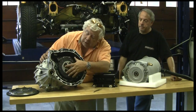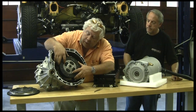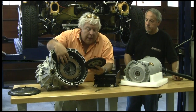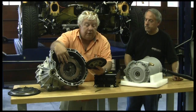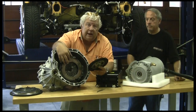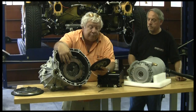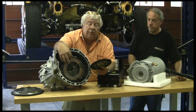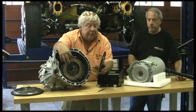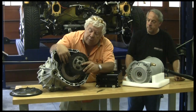We're going to keep the clutch — this is a brand new one. In the Speedster we had a pretty nice racing clutch, but we don't usually use the clutch at all. I want to keep it as kind of a last emergency disconnect. If something went wrong with the control system and you couldn't shut down your motor, you can always pop the clutch and blow the motor up instead of killing yourself. So we're going to keep the clutch and pressure plate.